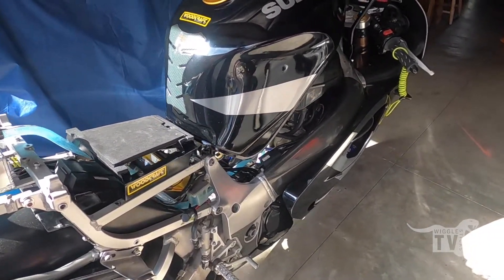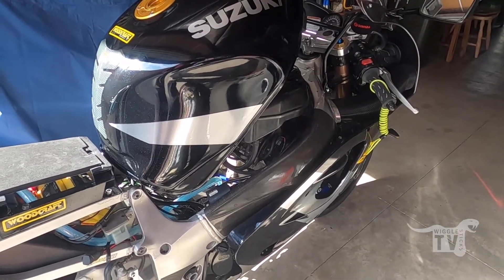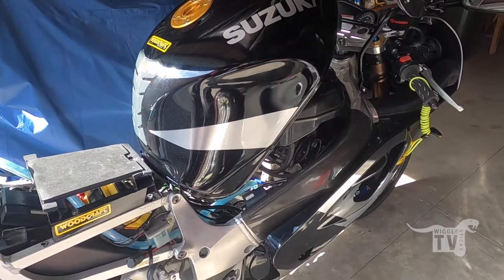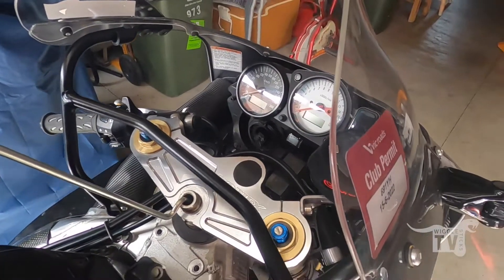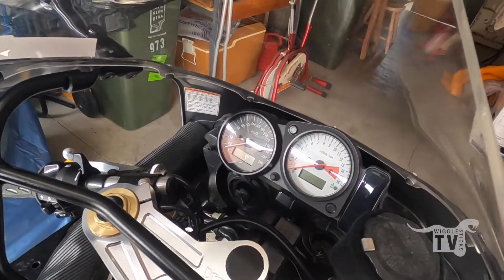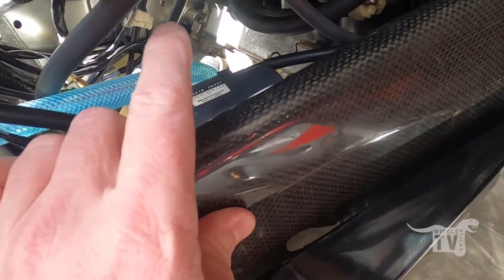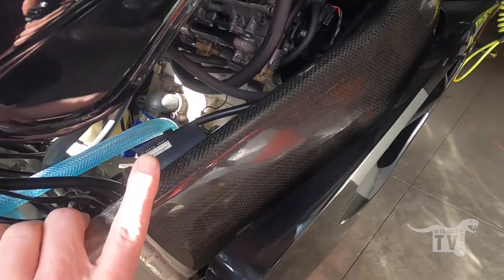The gift that keeps on giving. While this bike is back and running way better, it still has a hot start kind of problem. I rode it about 17k's, just around little loops within 5k's on the weekend, and it still has similar problems. Rather than the tacho and everything going up, this time it's almost like it's conking out on the lights. I actually think it's an ignition coil, maybe a weak spark problem.